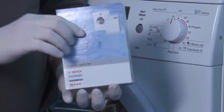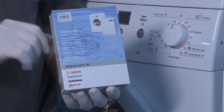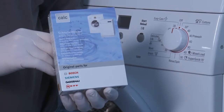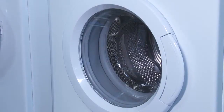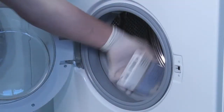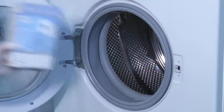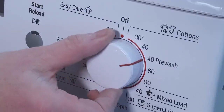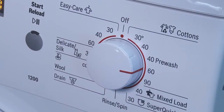Also, if you live in a hard water area, it's advisable to descale your washing machine every three months to ensure all limescale is removed from the appliance. Our descaler for washing machines and dishwashers is easy to use. The contents of the box should be poured into the drum with no laundry, then run the 60 degree colour programme without pre-wash to remove limescale from the appliance.